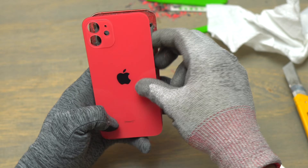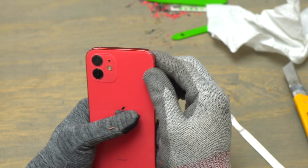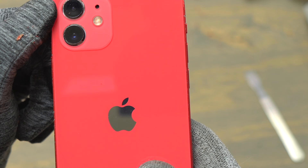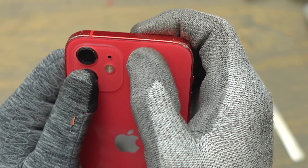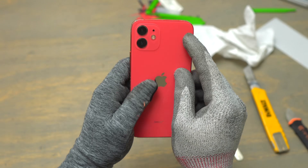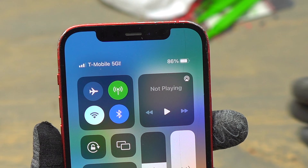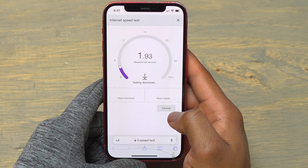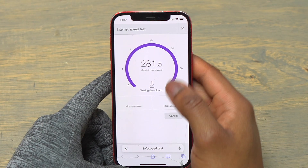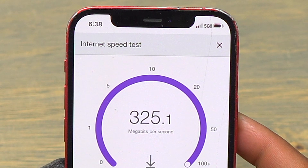This was the only glass I purchased for this replacement, and I kind of knew this would happen because the frame of this device is not in good condition to accept a new glass. The top right of the device was the point of impact, and despite being in a case — a cheap case — the frame got bent. If you're trying to do this iPhone 12 glass replacement, make sure you do not have any bend in the frame. I was able to push the frame out a little, but it wasn't enough. If you have a bent frame, do not try this — you're going to waste your time. Before moving to the solution, we need to check the device to make sure we didn't damage any component or hinder any functionality.